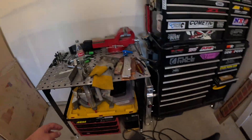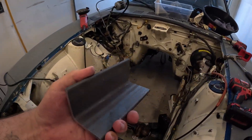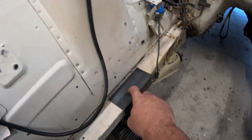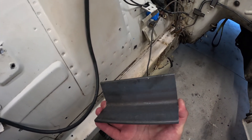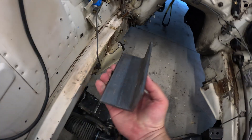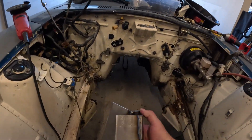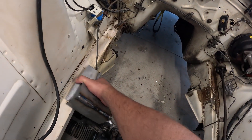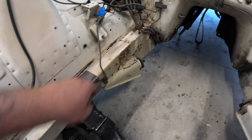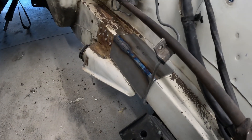I've been working on some stuff over in the engine bay. I originally bought some two and a half inch angle iron to put up on the frame rails further back, to give me an anchor point and disperse the load. However, the angle iron has a big radius in the corner and doesn't really want to sit down how I'd like. So I bought some regular flat stock instead. Got it really close and it sits way flatter. You get the frame rails cleaned up, get them down to bare metal in this area, weld these in place — it sits way nicer. I had to weld it up to get a 90-degree bend, an L, out of it.